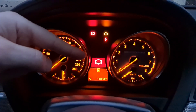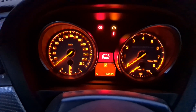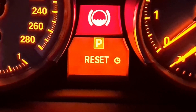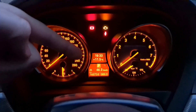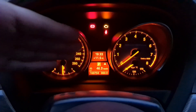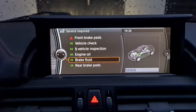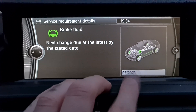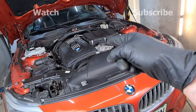Back in the brake fluid reset mode: press the stalk button and it will ask you to reset, press again and hold it, and it resets to the next interval which is in two years. I am a bit late with this fluid change but it's not too bad. If you check the menu in the iDrive you can confirm the brake fluid is reset and the next fluid change is March 2025. Thanks for watching, consider subscribing, and keep zen and continue the art of BMW maintenance.